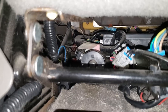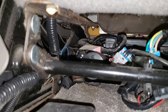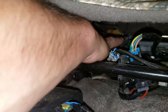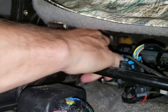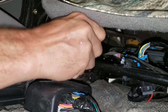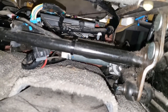Note that exactly where the velcros are sewn on is right where they have to be routed. Just poke them all the way through the back edge. When they get hung up, come around the back side and help them through. Make sure you avoid all the electric controls and any wires that control the seat.